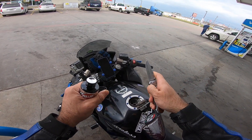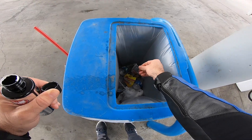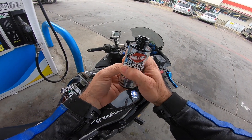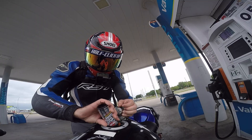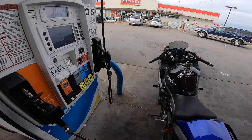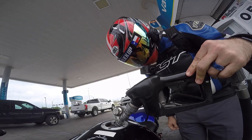As is customary in the weeks leading up to a track day — in this case, just about two weeks out — we drop in a bottle of Redline, because she likes that kind. Just to give the pistons and all the things and the valves a nice good cleaning, in preparation for running VP Octanium through her, which essentially bumps us up to about 104 octane. The four-degree timing advance really likes that a lot. That's how we roll on the racetrack.